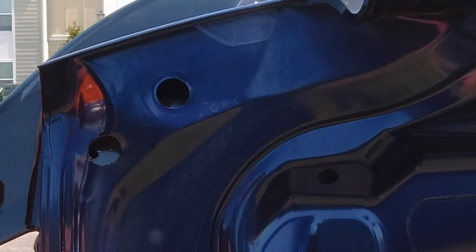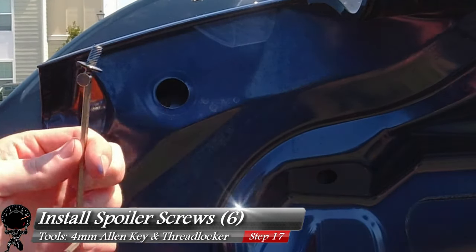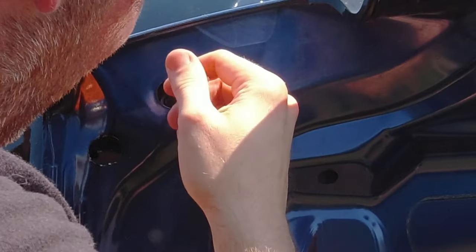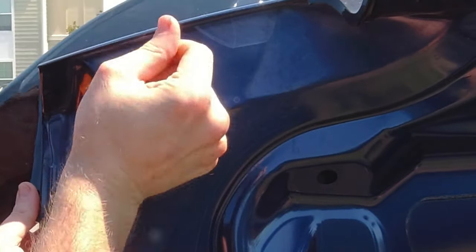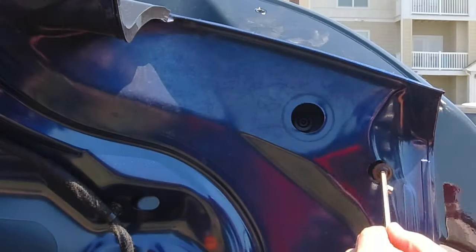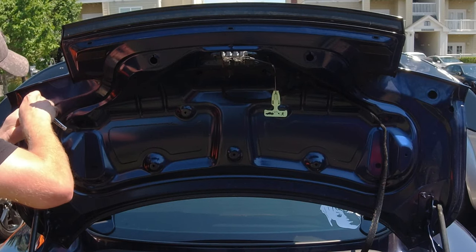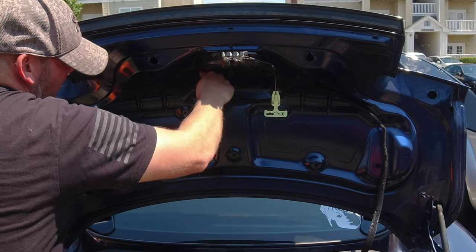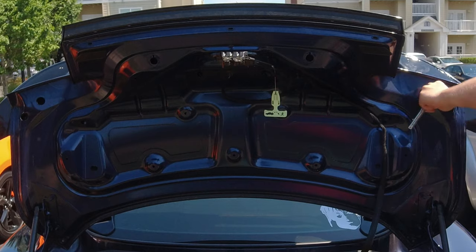Since this spoiler doesn't have tape, we can skip all that and go ahead and hold the spoiler right to the trunk and install our screws. Let's grab some thread-locking compound — this one requires an Allen key to install the screws, though some require Phillips screwdrivers and some require torque wrenches. Very carefully start the screw — try not to drop it in the trunk; if you do, you've got to take the whole trunk off. A silver magnet attached to the Allen key helps make sure you don't drop the screw as you're screwing it in. The camera overheated during the middle screws, but I just started them by hand and then tightened them with an Allen key. Now I'm taking a quarter-inch socket wrench to tighten these up nice and snug — go over each one at least twice to make sure you got all of them evenly.